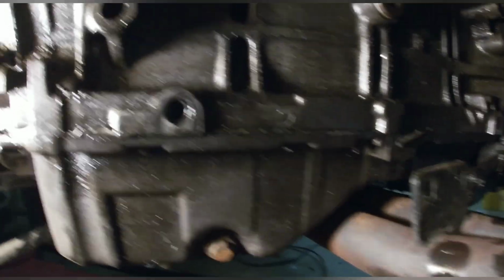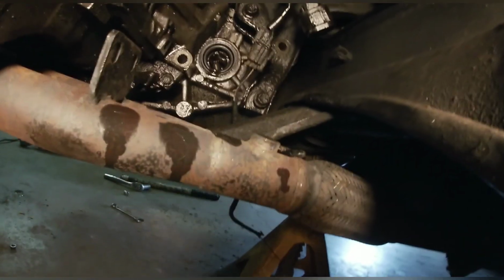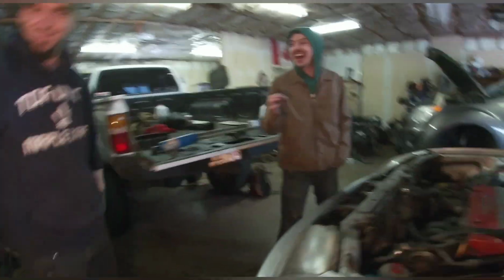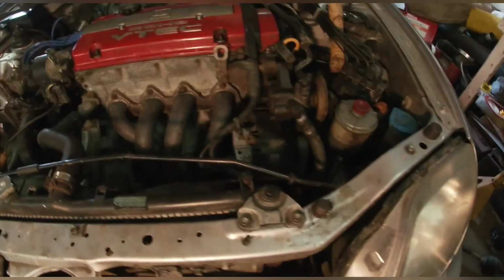But on an SH, where's the O2 sensor? Why is it not in there? On an SH, you only have that one bolt, so there's none in there at all. A little bit of blow by won't hurt nobody. I just noticed it's just an open bung. Maybe they had a wideband, they took it out.